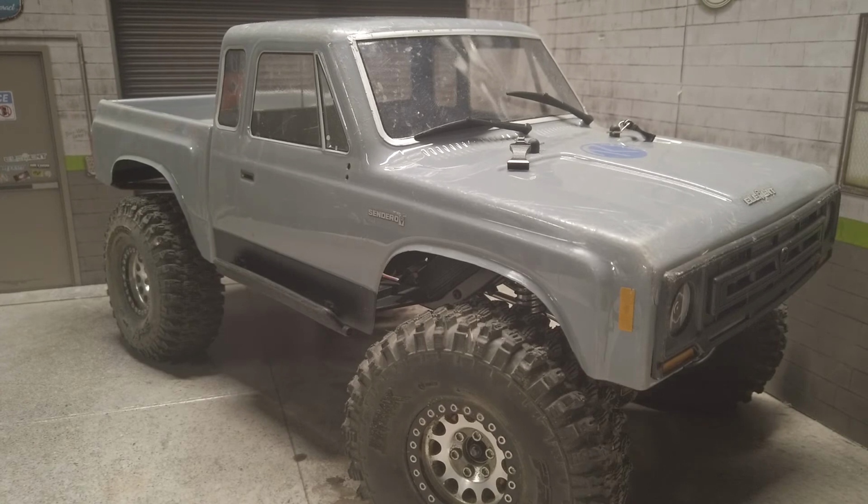The additional weights definitely played a bit of havoc with my current shock settings, and I will need to look into adjusting them, either with heavier shock oil or springs or a combination of both. I did like the added stability and the traction, so the final verdict will have to wait until I retest after the adjustments.